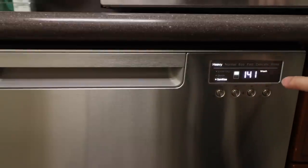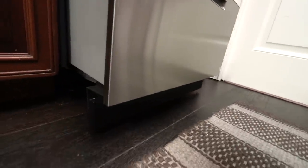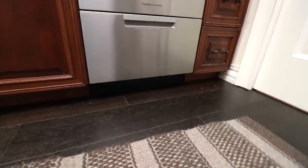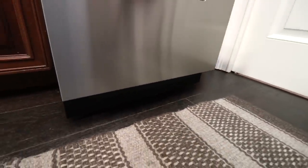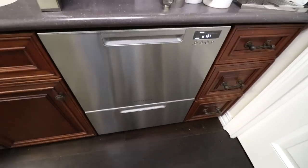Sanitation mode works great. Another thing to keep in mind is the way this dishwasher opens, especially the bottom drawer. The toe kick comes with it — you can see as I open it, the toe kick actually comes out with it. So that's another installation consideration: if you've got a nice toe kick with your cabinets, it's going to need to be cut and attached to the dishwasher itself so that when the dish drawer opens the toe kick comes with it and then goes back. That's another reason to make sure you use a good dealer when you're buying this unit and getting it installed.